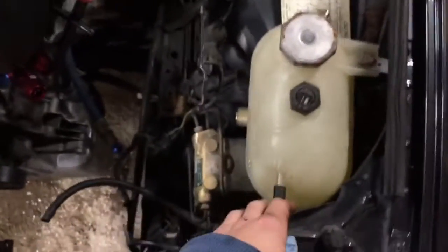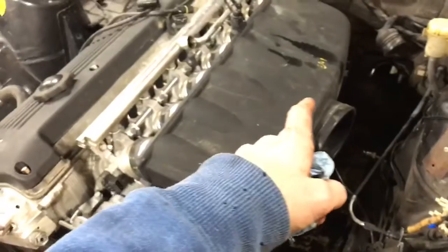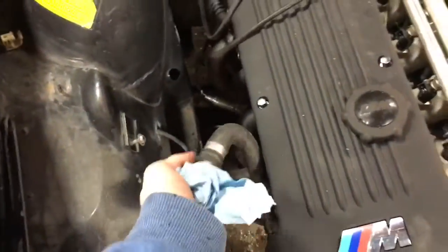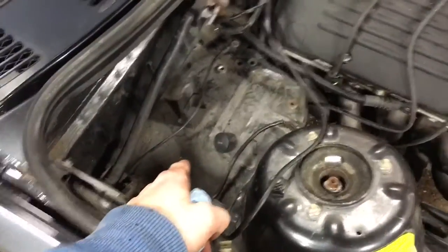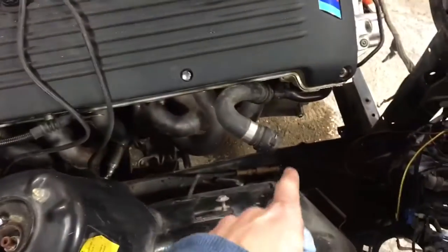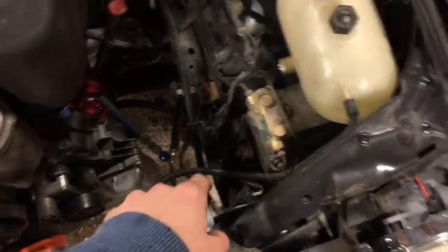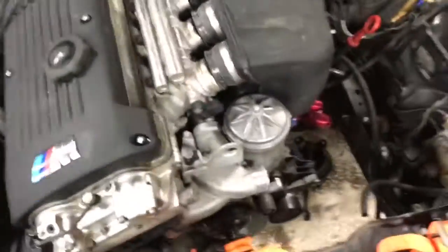The expansion tank here won't be here anymore. On the S52, it's got a coolant spider hose that runs underneath the entire intake manifold, with a jut-out that would attach to the bottle - on the S54 it's over here. Luckily the E30 M3 originally came with a coolant expansion tank right here, which is perfect. I'm just going to extend that hose a little bit over, then run a small capillary tube all the way around to that little nub on the top of the radiator. Cooling system is pretty straightforward.